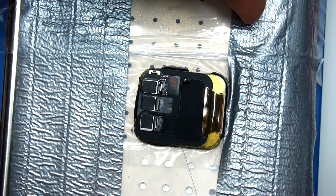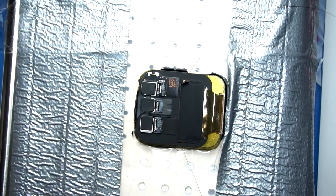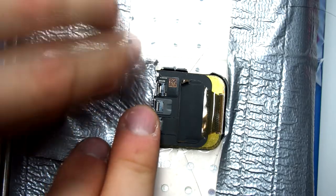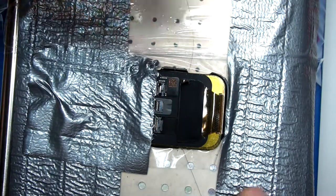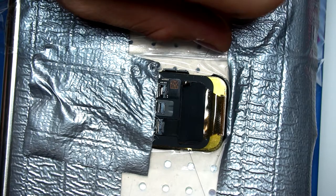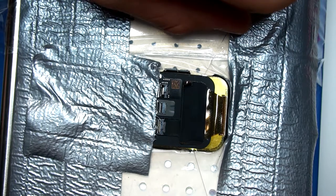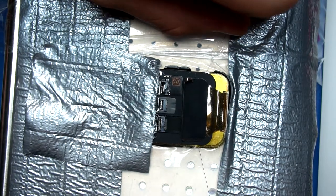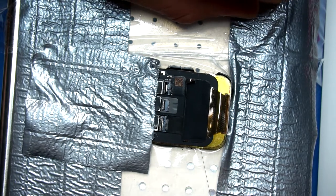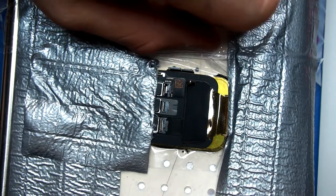For holding the display on the plate, I use a vacuum machine. You can also buy it in the description. And because sometimes the glass breaks very badly, you have to use tape for helping the vacuum machine hold the OLED screen. The vacuum machine is also heated up to about 90 to 100 degrees. That's the best temperature to separate the OCA film from the OLED and glass.